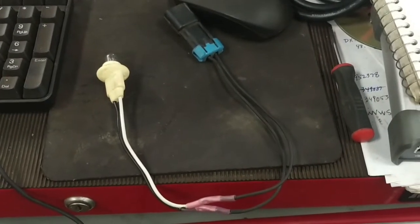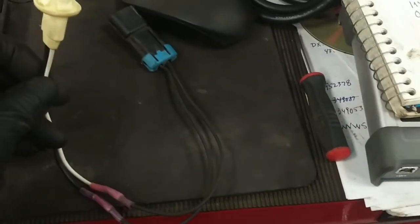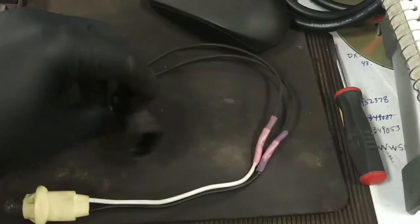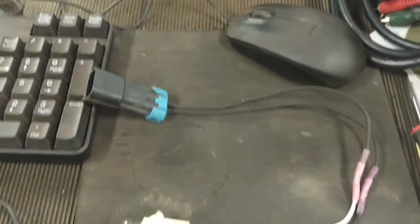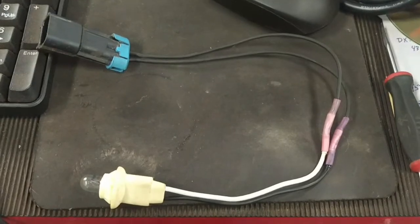Here's what I'm going to do temporarily: I'm going to wire in a test light, which is basically a side marker pigtail. I'll use the connector off of the existing harness so that it's sealed, and just tie it up underneath the turbo. There'll be a little light down there, but that'll fool the system into thinking it's working, because the turbocharger has been mechanically altered to not use this circuit anymore.